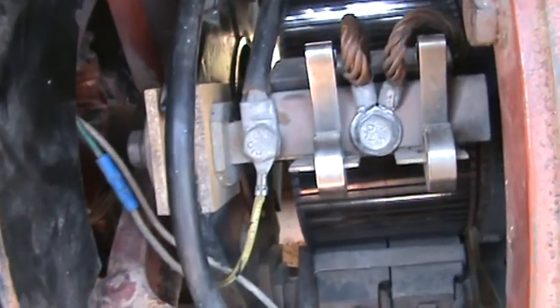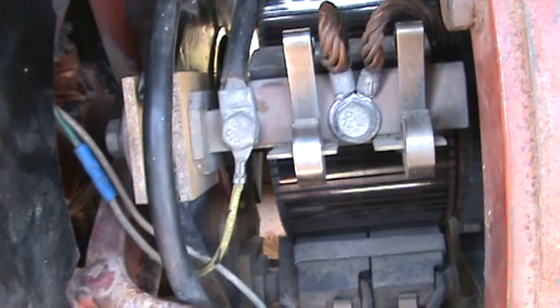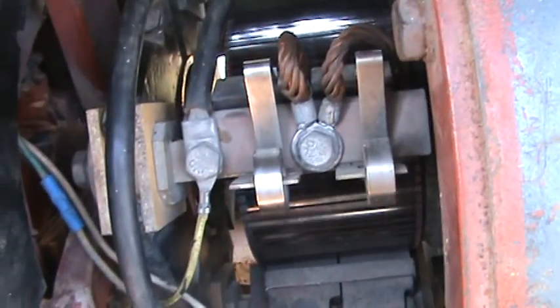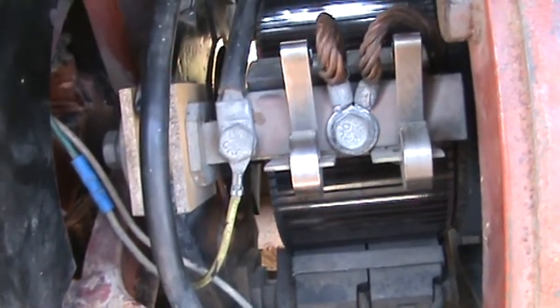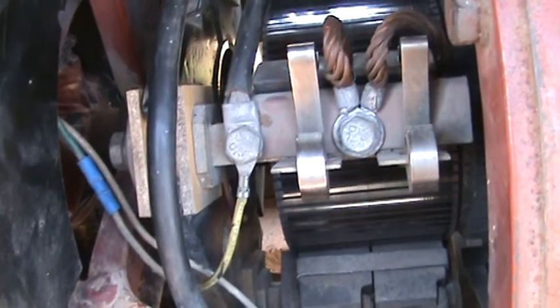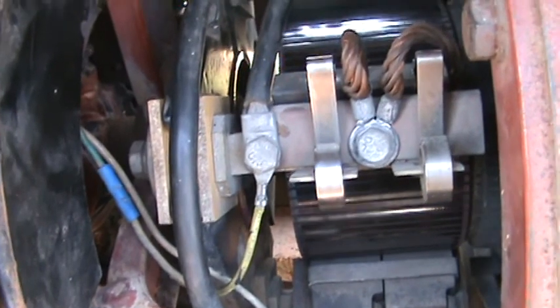When you're rolling the brush racks, the only thing you can really screw up is getting it too hot — it's like engine timing. You don't really want to move them much. I had to move this one eighth of an inch, so it was out quite a bit. I didn't move an eighth at a time though — I moved a sixteenth at a time until I got to an eighth, which is two little turns.